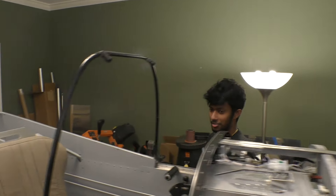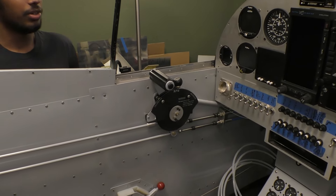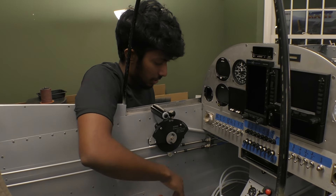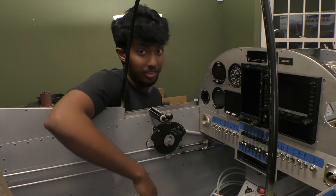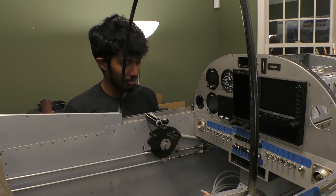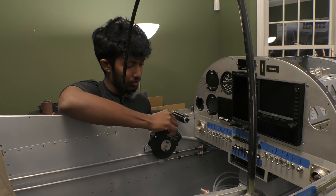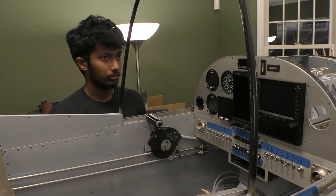I'm going to have Lithra show you what he did over on this side with the actual controls. So as you guys saw, we ran the control cables through the firewall at station two. Then I built a bracket that sits right here where I fed all the control cables through and put rod ends under the quadrant. Overall I think it looks great, works really well. Really nice cables as well — it's all just coming into place. I love the way it's all coming together. It moves really smoothly and just ties both of those together and it's rock solid.